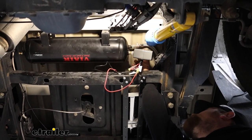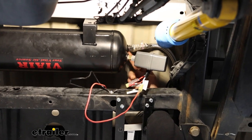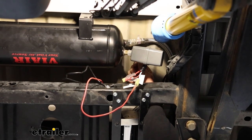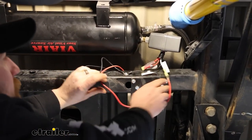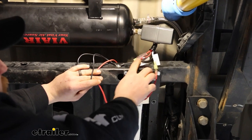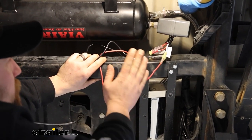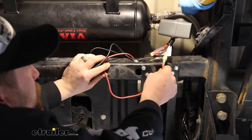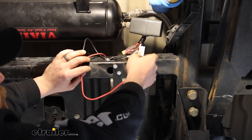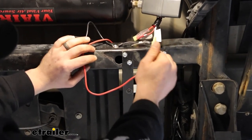From there, take our airline coming out of the compressor — it will just thread into an adapter that comes in the kit. Put your pipe sealer on there, throw those in, and then screw it right into the tank just like you did the other fittings. The wires we're going to hook up: you're going to have a black wire labeled 'connect to grounding point or control switch' coming out of our relay. The black wire from the compressor — use a self-tapping screw and run them through; they already have ring terminals on them, so it's pretty convenient. The red wire coming out of the compressor just plugs into the white wire — that's the white wire from our regulator, labeled 'connect to load or compressor power wire.' So it just plugs right in.